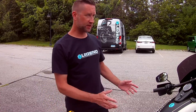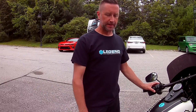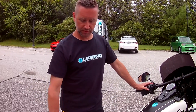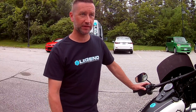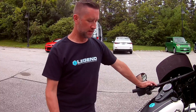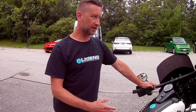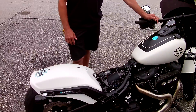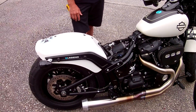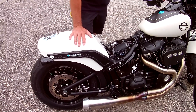You're not going to rub the tire on the bottom of the fender, and you're not going to pinch any wires underneath it. So for the customer that needs that confidence — either backing the bike into a parking spot or stoplight to stoplight — it's a very valuable piece because it allows them to ride the motorcycle they want that maybe they didn't fit before. When they get out on the turnpike and ride for a couple of hours, they can push the top button on the controller, air the system back up into the full range of motion, and have full suspension travel.